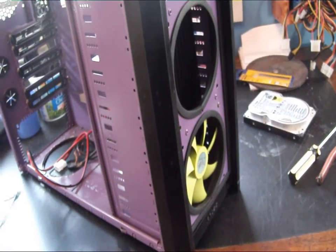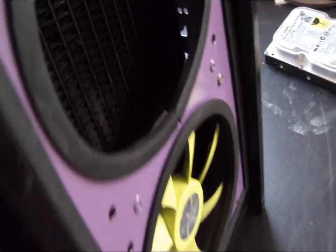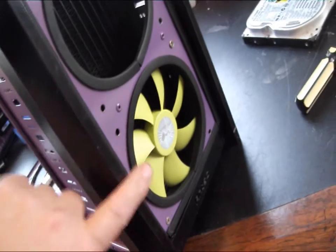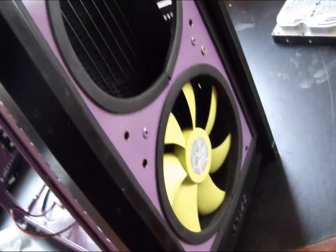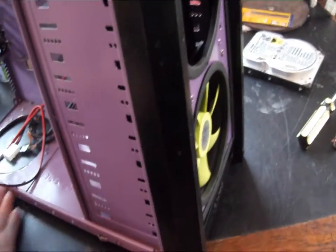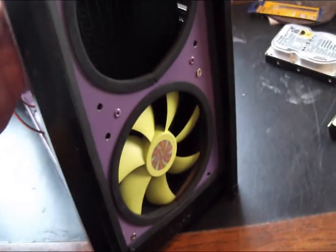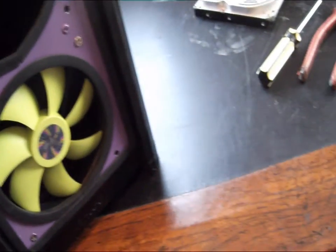Then I just put this spare fan I had laying around on here as a kind of a mock-up to see how it would fit. Because what I was thinking is, if I did use it in here, I didn't really want to mount the fans right on the radiator — I want to keep them on this front plate so it'd be easy to pop that off and clean dust out. But I didn't want to leave any air gap between the radiator and the fans so air would blow around it instead of through it. By taking that little ridge out, I can push the radiator right up against the fans.